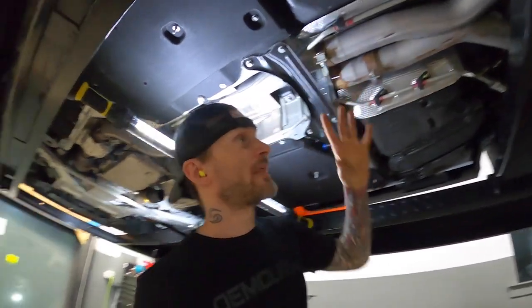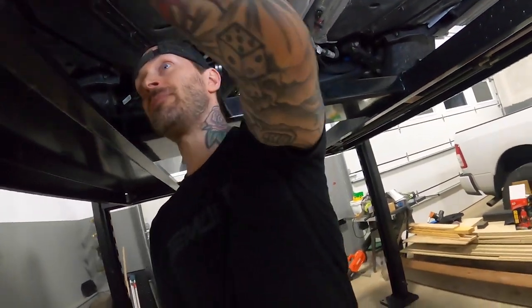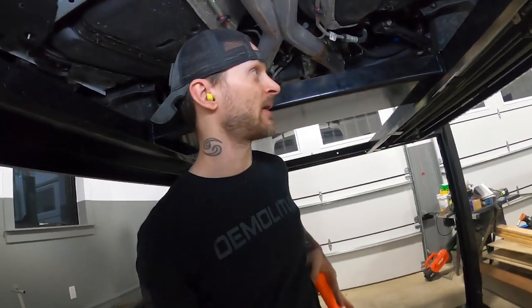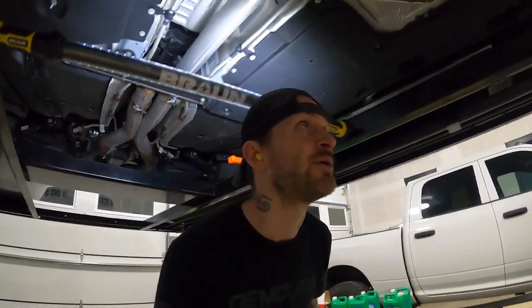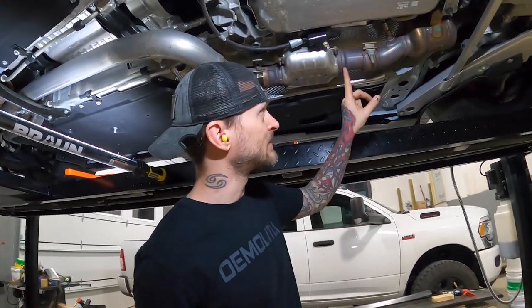All of these clamp-on styles are a pain because once the clamps are on they basically pinch the pipe ever so slightly and then you can't pull it off. But I went and got a set of dead blow hammers so that we don't hurt the exhaust pipe, and luckily with that almost 90-degree turn on there, once we loosen those up we kind of just hit it off and pull it out - and it was at least able to come off of this side. So we're 50 percent done. Wish me luck on these other two cuts over here, and then I'll head to an exhaust shop, flare the mouth open a little bit to get over top of these pipes, weld them up. I'm still waiting on the four two-bolt flanges to show up so we may not be able to finish it today.